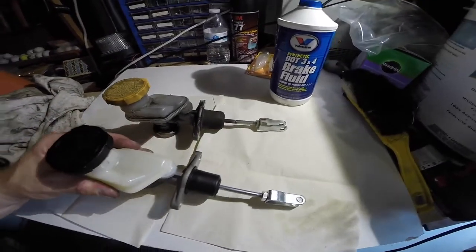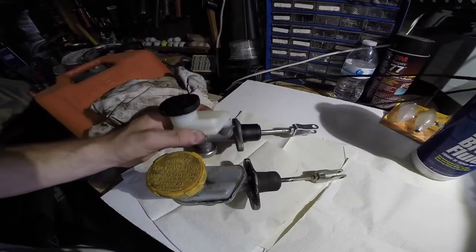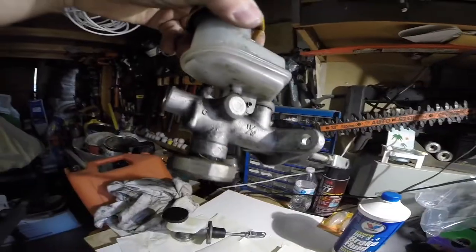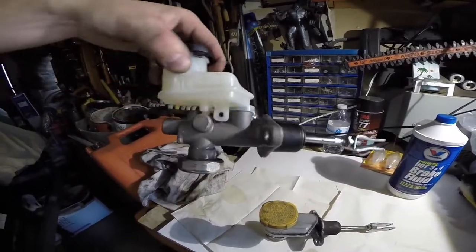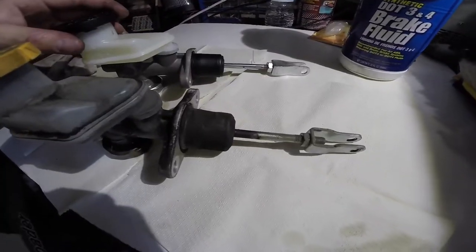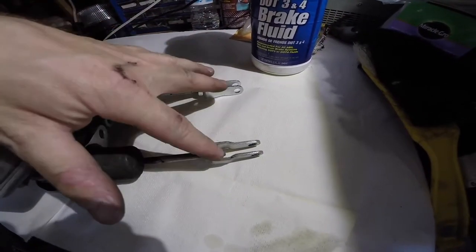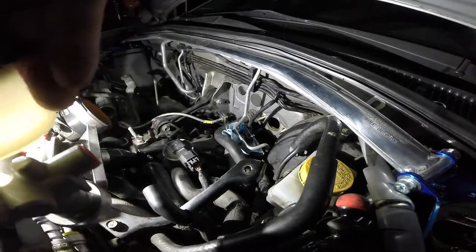I just wanted to do some comparisons here — old versus the new. It's pretty identical. It's not an OEM Subaru part, it's just from AutoZone; I'll have the part number in the description. You can see my old one is completely worn out — it's seen better days, and this is where it was leaking out the bottom, so this thing was way done, way past its life. I also wanted to check out the linkages and see where it was set — compare the old one to the new one, make sure it's somewhat in line with where my old one was so the engagement point and pedal feel is somewhat similar. Out with the old and in with the new.